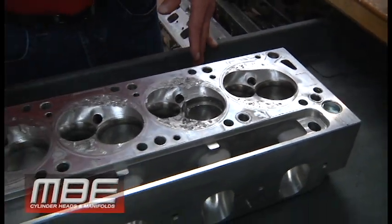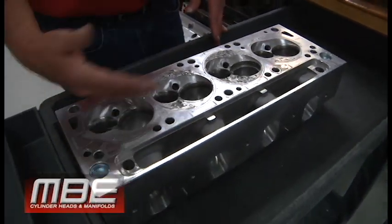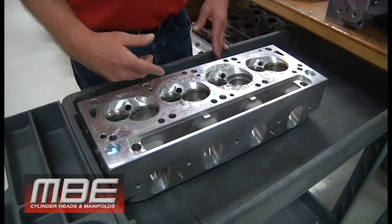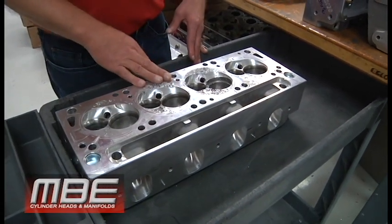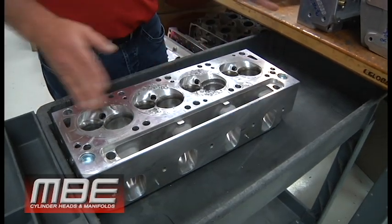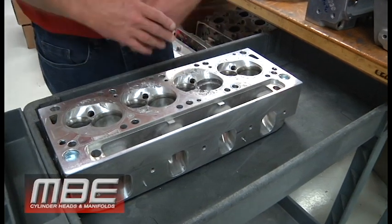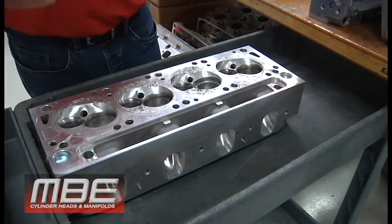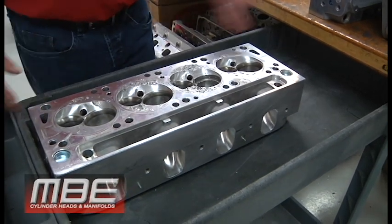We're updating the intake ports, the exhaust ports, and the chambers. We can see from this program right here that there's probably 20 CFM in just updating the chamber alone in mid-lift numbers. So those are always nice to see because that's kind of a freebie. So all of this will get updated. All that chamber is going to be laid back more. All the mid-lift numbers will come up, and it'll make more torque. It'll just be more efficient. That's all we're trying to do.